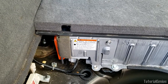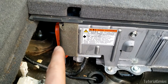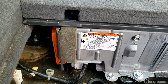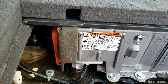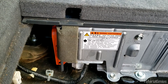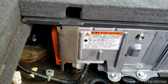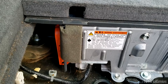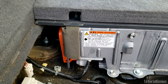If you're going to work on the hybrid battery or near the hybrid battery, it's best to remove the service plug which is this orange plug right here. The orange service plug is designed to remove the hybrid battery from the rest of the system so it's isolated. Remove this plug and wait five minutes before servicing it. If your car gets into an accident, first responders usually remove this plug to prevent unsafe situations like fires or electric shocks.